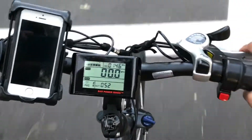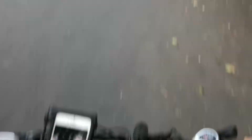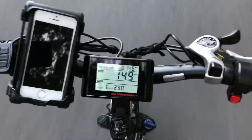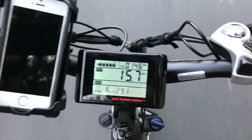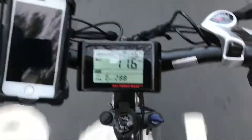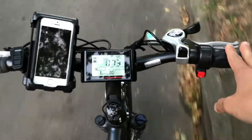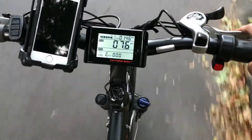Getting the motor to activate — there you go, got some wattage. Alright, now it's cruising — and there you go, I definitely feel regen here. I'm not actuating my mechanical brake at all, just regen. Getting to the school sign here — about 12 miles an hour, with a max of about 15 to 16 miles per hour. Compare that to without regen down that hill.